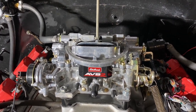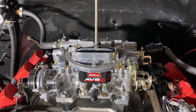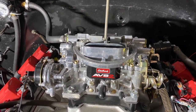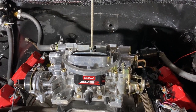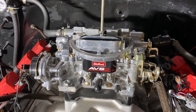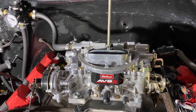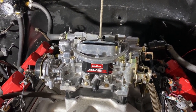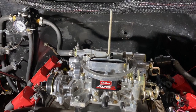I'm not going to explain jets too much because people mostly know their application. If you've got a stock 350, you're not going to put an 800 CFM on it — you'd run something more like a 650 or a 600. Relatively, the jets from factory are pretty close to your application. The jets really aren't that big of a deal unless you're running a radical camshaft, big free-flowing headers, single plane intake, and making crazy horsepower — and then you already probably know how to change your jets.